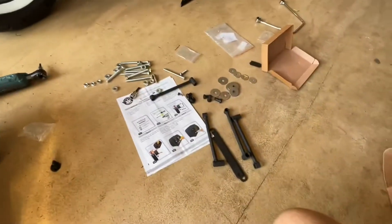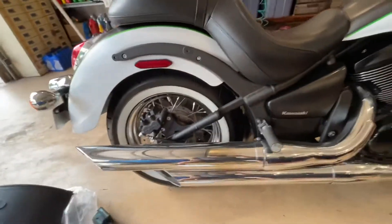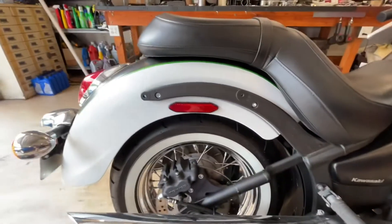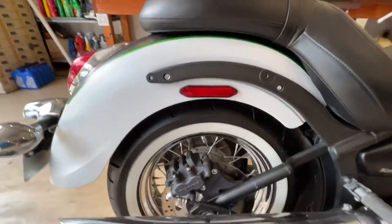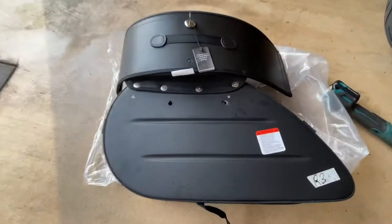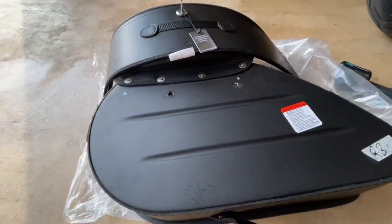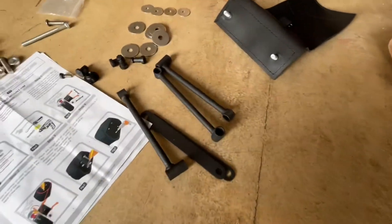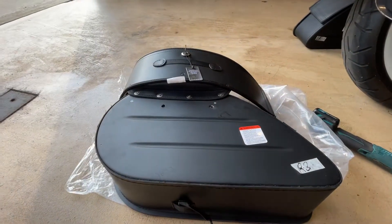It's not going to be a 10-minute job. It's probably really specific to my bike. It had these trim pieces that always looked a little mismatched — gloss black while the whole frame is a satin finish. They looked a little unfinished, maybe even from the factory. Anyway, they came off and I don't need to reuse them. I'm just going to bolt the bags right onto the two mounting holes where those were mounted and the bags are going to cover it up — it's actually going to look really good. I've measured things out. These are very much a drill-to-fit situation, with holes to drill for the top of the brackets, making a U-shape that loops down and bolts in four places.